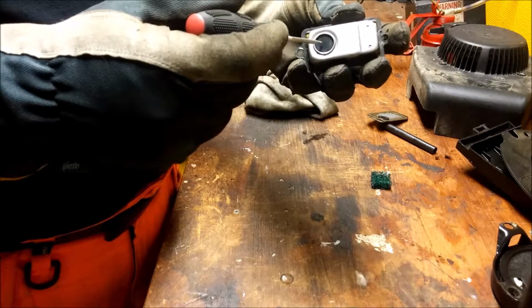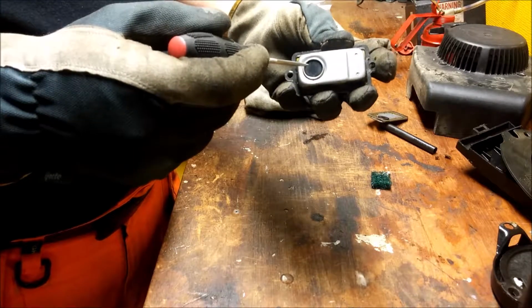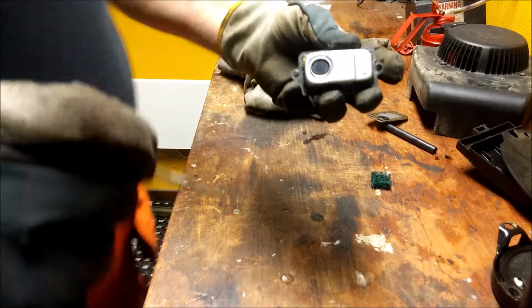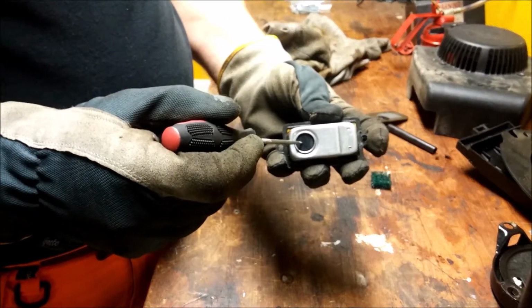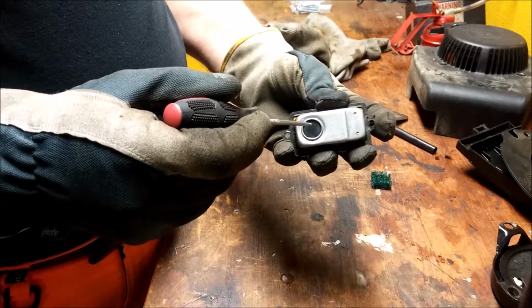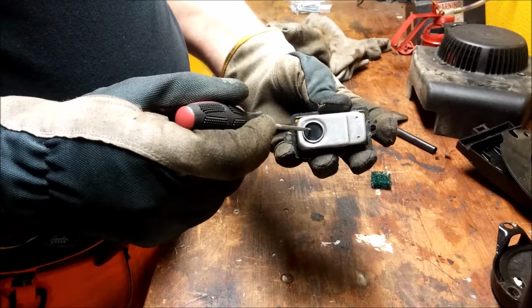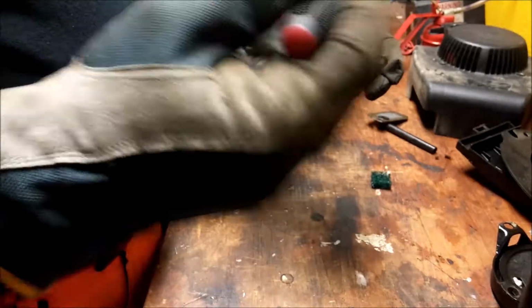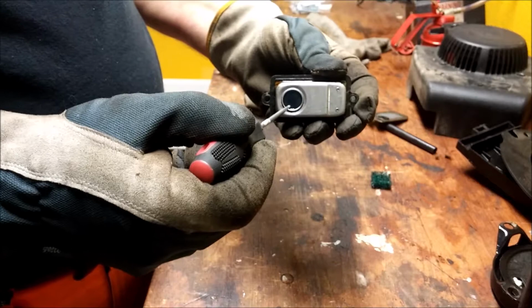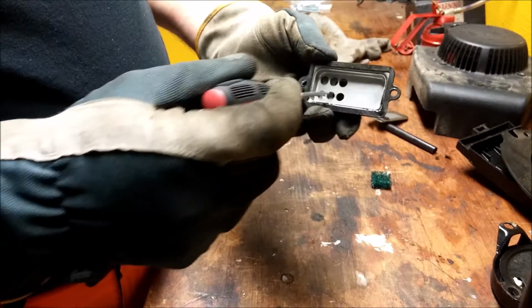So I started looking at YouTube, and I found a tip from another person that did this. They showed me. So there's a link to the other YouTube video in the description. But here's what the problem is. The crankcase ventilation is always going to bring oil up with it, and it's going to go out through this membrane, out in this area.